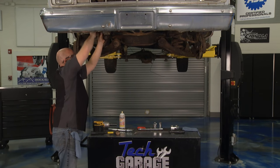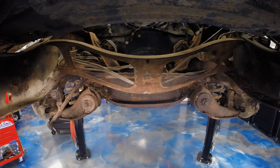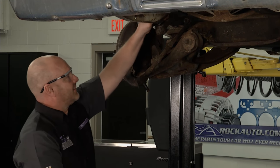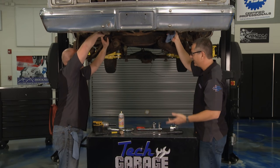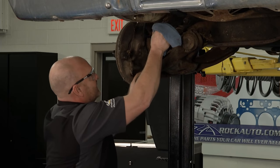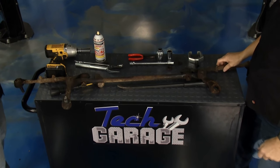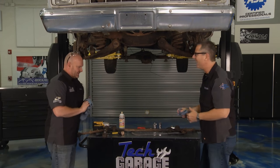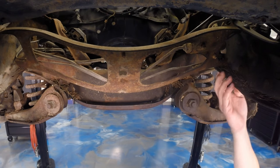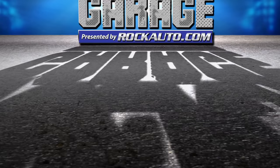Making great progress. Instead of the puller, let's go old school — give it a little leverage and hit the top. There it goes — broke loose. We rolled it down and out, brought it right to the bench. Just like the demo, just much dirtier. What we need to do now is swap these parts, count the threads to get the alignment really close, then take the gearbox off — there are just four bolts holding it on — because we're replacing that as well.